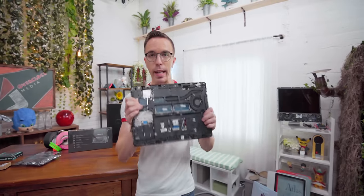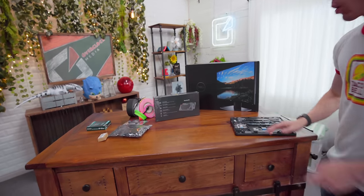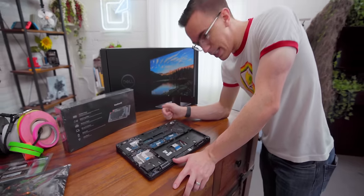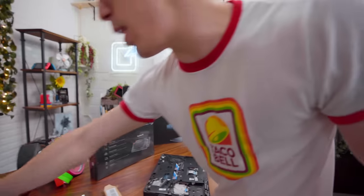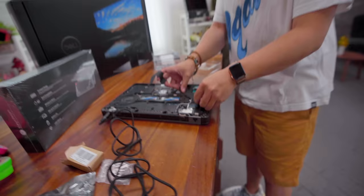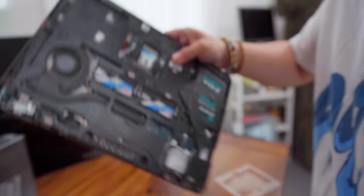Step one is getting our Dell laptop up and running. We have a wide variety of parts to try to do this as cheaply as possible — probably the same price as buying a working Dell, but this one's going to be cooler, as long as you don't care about the aesthetic. Since it's been so thoroughly stripped, it's never going to be portable again. So we're going to install some RAM, since it literally needs that to function. Next, let's install an SSD — I have a 240 gig SATA SSD. It's secure.